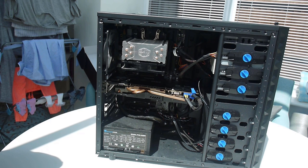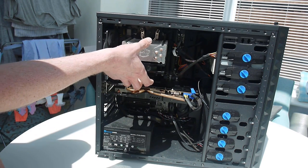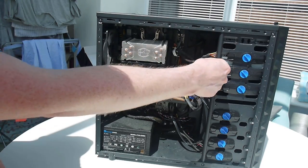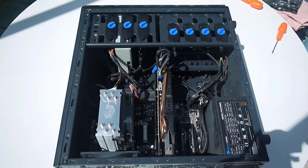That coupled with one fan at the front sucking cold air in, and the PSU facing downwards, so that isn't even acting as exhaust, means we've got a whole lot of confused air. Plan is to rotate the Evo 212 90 degrees and spin both fans around, so one is pushing air through the Evo and the other is sucking that air out the back of the case.